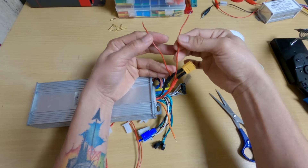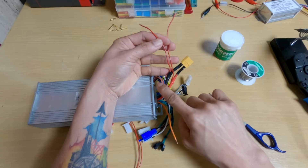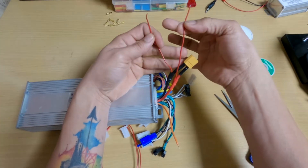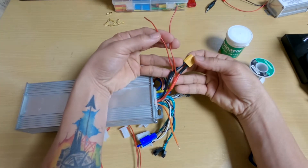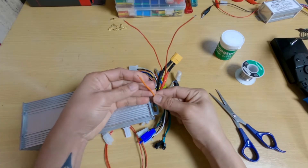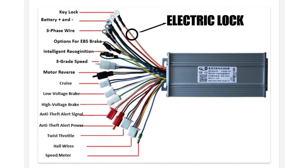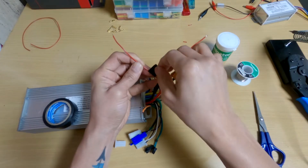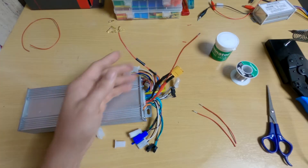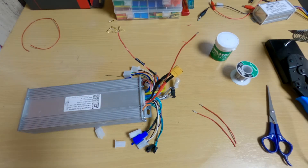The result output from the converter is 12.36 volts. After I tested the converter, I began modifying the wirings of the controller. I already pre-soldered 2 wires — one on the red positive power line wire and another on the black negative power line wire. The power line wires are for the battery or power source. This orange wire is the power lock or electric lock, sometimes called the switch wire. To avoid mismatching the wires, I put black electrical tape on the pre-soldered wire connected to the negative power line wire. Always remember: red is positive and black is negative.